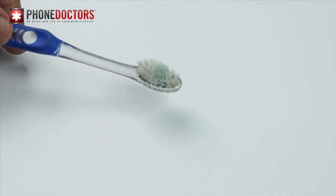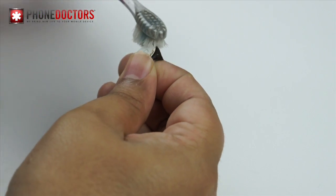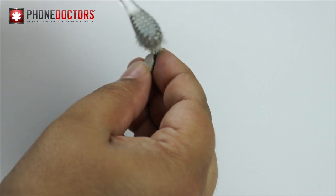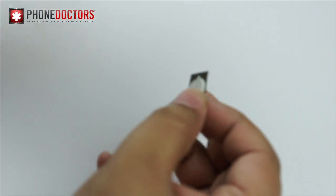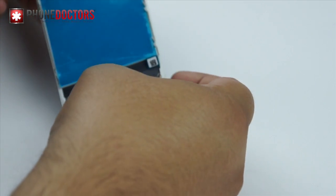The best thing to do is just take an old toothbrush and scrub that down — get rid of all that excessive dirt. If it's really thick, it's not bad to use a little bit of alcohol; I wouldn't drench it. Once you do that, just sit the home button back on your digitizer, whether it be the 4 or the 4S, and put it back together.